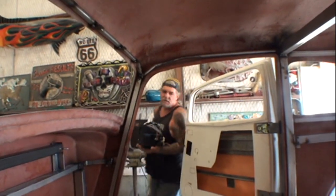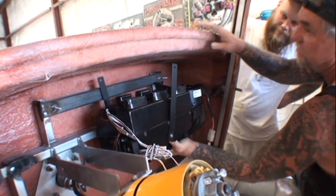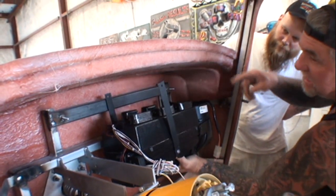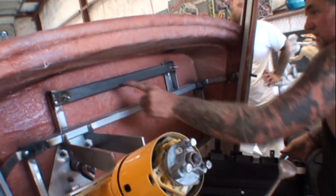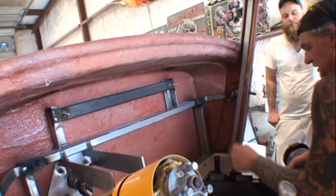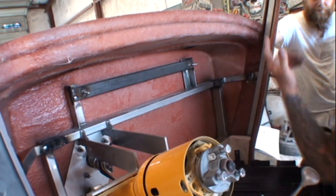What we got to do here is this AC unit has to be installed in the vehicle. So we want it mounted right here. You're going to have to build a tab over there, a tab here, and then this one is going to go way over there, and you're going to have to build a tab from here to weld this one on. I would actually find the hole there, drill and tap. Okay, so there's one hole, and then you can get a piece of that flat steel over there on the floor. Then you can also put a tab coming out here. Drill and tap.